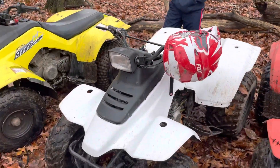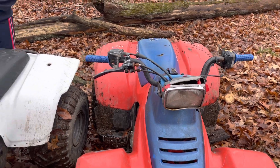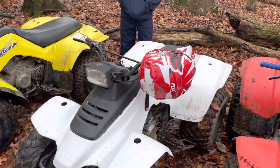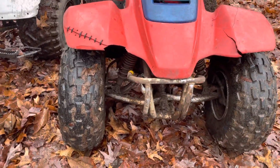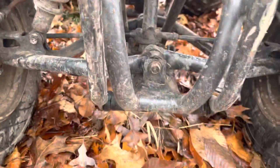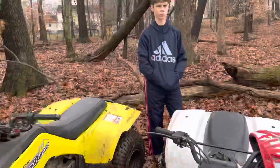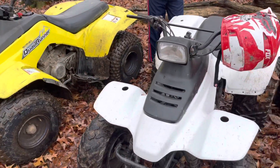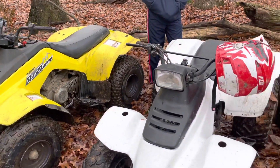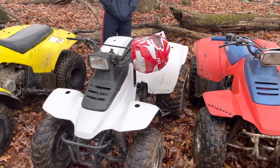All the parts are interchangeable. There are minor differences — like the old headlight that's been bashed up because his friend rolled it at an ATV park — but basically they are the exact same quad. They have independent front suspension. It doesn't have a lot of travel, but if you keep the tire pressure at around 5 psi, they ride really well. They hook and have good traction. We went out with friends on big four-wheel-drive 500cc quads and they were shocked we were able to keep up.